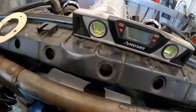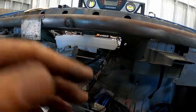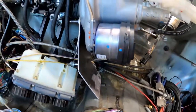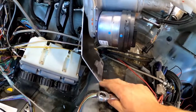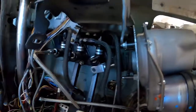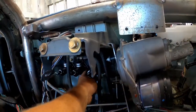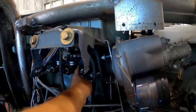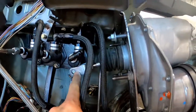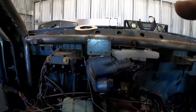I've got plenty of room to remove the cap and fill it from up here, and it's perfectly horizontal both ways. This is what our mounting bracket system is going to look like - it connects to the firewall and transmission tunnel area here, then up to the steering column mount. The way everything's going to work is I'll pull off these two master cylinders, connect the pushrod through the hole for this master cylinder back to the brake pedal. The push rod will come through and connect to a rocker which will actuate the power brake push rod, and then we'll have power brakes. I'll get this welded in and jump back on it tomorrow.